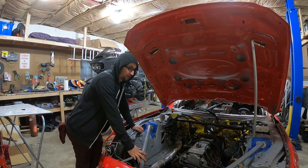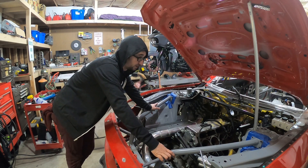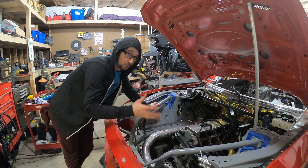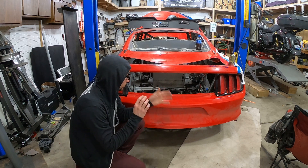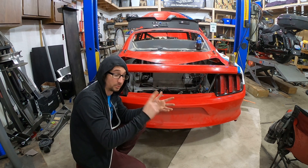One of the least-touched parts is the suspension. The angle kit and sway bar are done, but we still need front coilovers and camber plates if the ones that come with the coilovers won't work. In the back, subframe bushings and diff bushings are done, but we need toe arms, camber arms, and vertical links. The stock ones have some adjustment but the bushings suck — we want to switch everything over to spherical bearings.